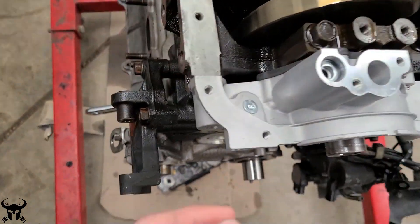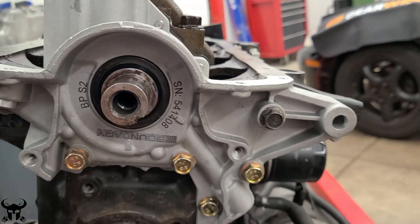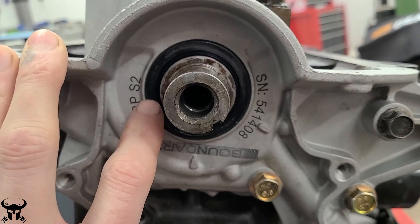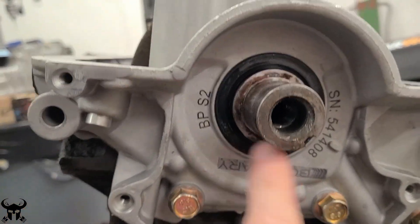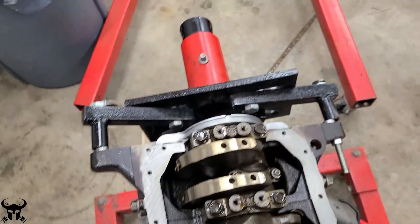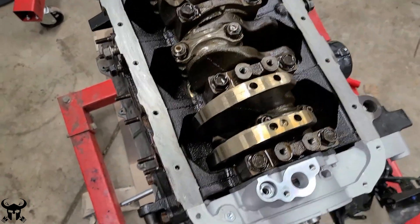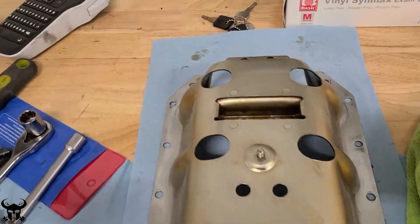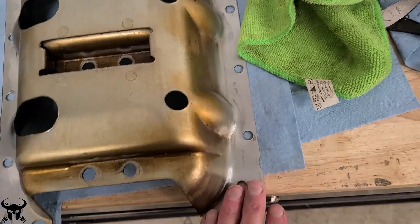I got this silicone set up for a couple of hours last night and then I tightened everything down to 19 foot pounds. I used all new grade 8 hardware on this boundary oil pump and I was able to get this seal — this is a National seal I picked up at AutoZone. I ordered one that looked exactly like it dimensionally but it just did not fit right and didn't make a good seal. There's the pump and this is the mating surface where the oil baffle is going to sit and the pickup tube connects here. I have the oil pan just draining oil right now. I just had the baffle cleaned up with a Brillo pad and then went over it with brake parts cleaner a couple different times.